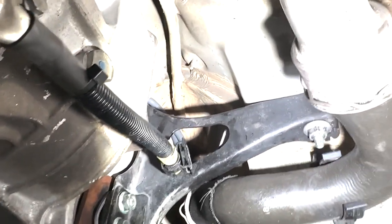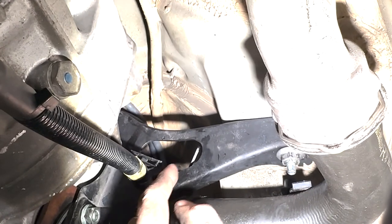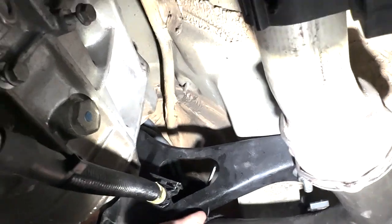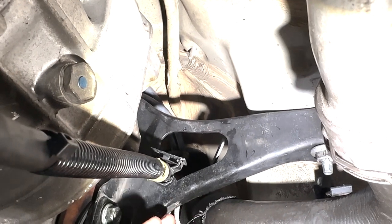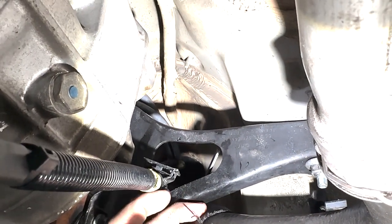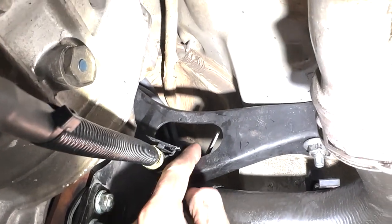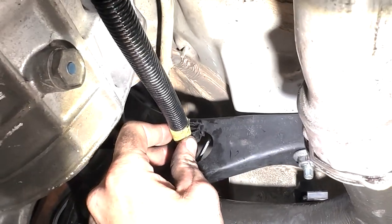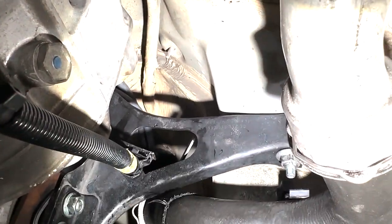One other thing to note: the battery cable has a clip that attaches onto a metal clamp on the cross brace. When you move it back, where the cross brace is, it will hit the rad hose. If you don't bend it up out of the way or cut it off, you are going to end up with it rubbing on that rad hose and you will get a massive coolant leak at some point. So bend it up and then relocate the clip or zap strap it up there instead. Be careful that you do that — or else, leaky leaky.